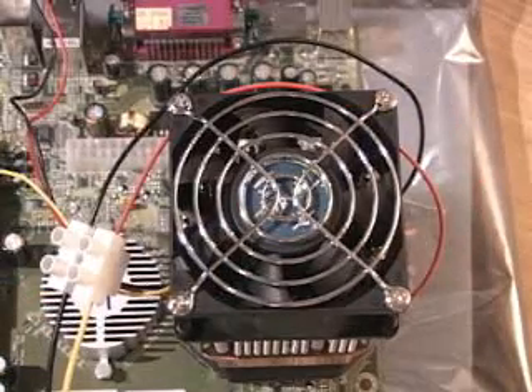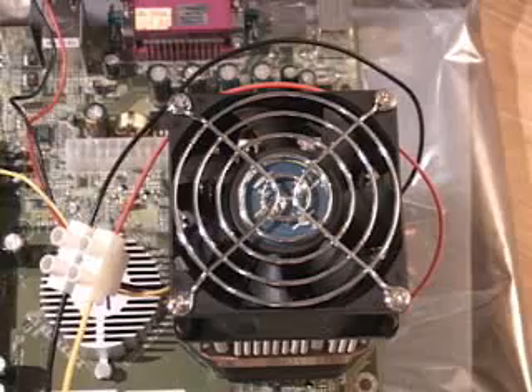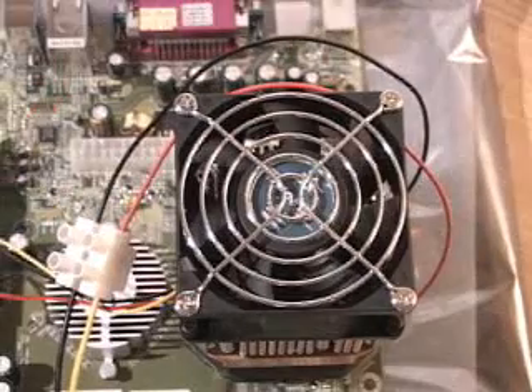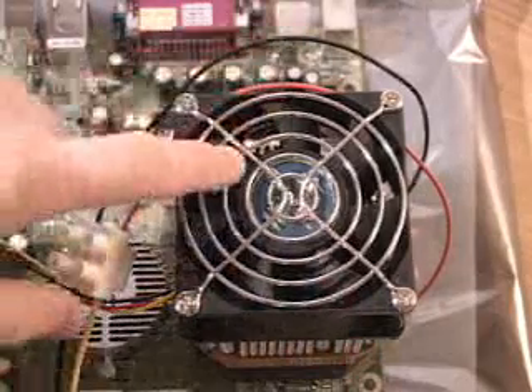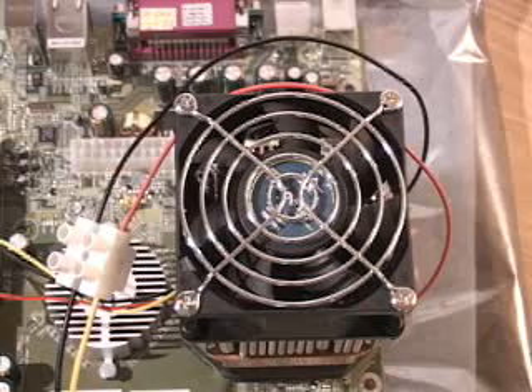Just to give you an idea of the type of fan needed to keep this product cool, I'm going to turn on the Vantec 80mm Tornado fan. The results were very good — when you have a heatsink like this coupled with an excellent fan, you'd expect fantastic results. I was using an AMD 1900+ with a Vantec 470 watt power supply, and was able to get it up to around the 2200+ range using a voltage of 1.85. The idle temperature was around 10 degrees Celsius and the max load temperature around 35 degrees C.